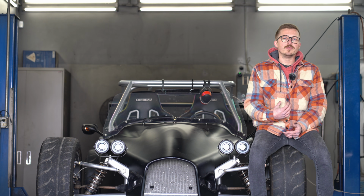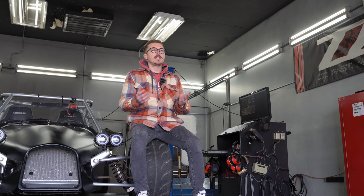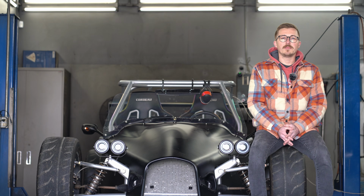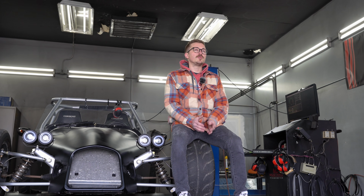Now we are used to the Cobalt SS and the Ion Redline, where you're able to run a big heat exchanger out front and keep those intake temps down. Last year, fourth gear pull, we were nearing 170 degrees. Now, that may not mean much to you, but in terms of IAT2s, that is extremely hot.